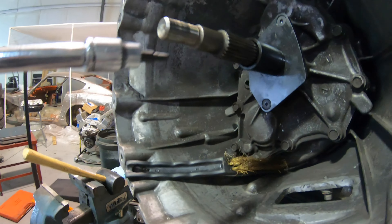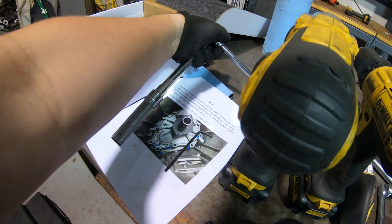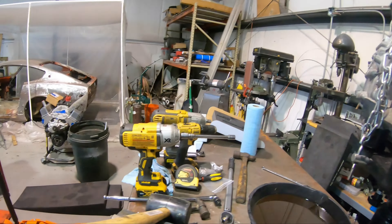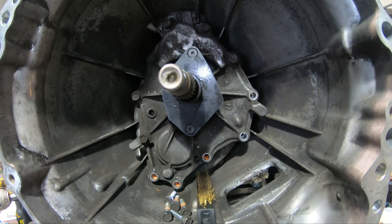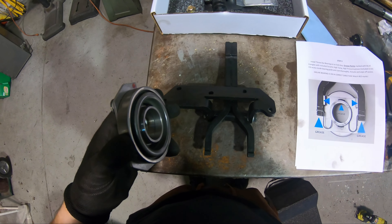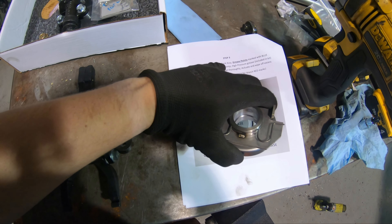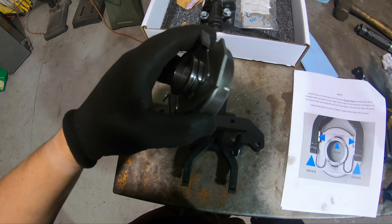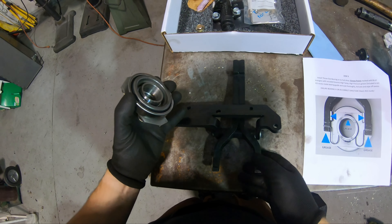You can see there are some keys on the back that you're supposed to line up. Make sure it's nicely centered when you tighten up the bolts. I'll put blue Loctite on them, hand-thread them in, and then torque to 80 inch-pounds. Got them done.